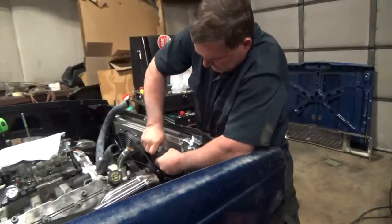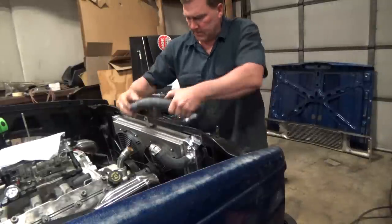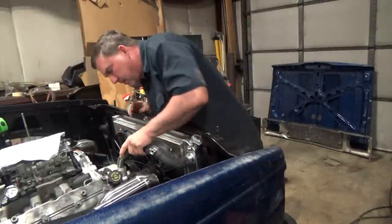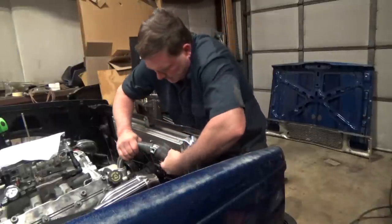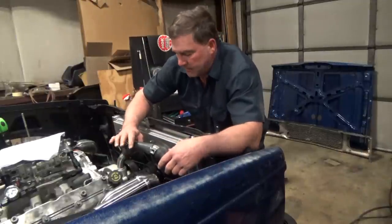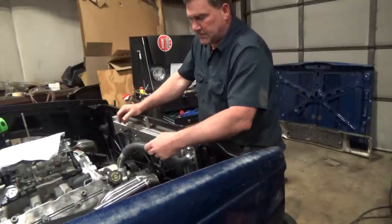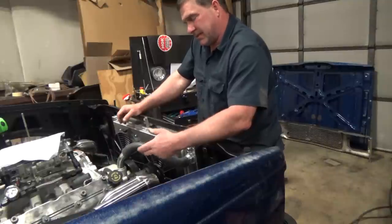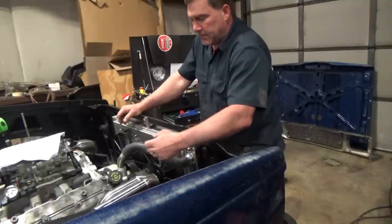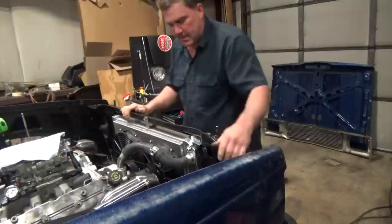I'm going to have to take this all back apart to put my clamps on, but that's okay. If we have a pinch where it kinks after it gets hot, we can actually wrap a hose clamp around that spot — it'll help keep it open. If I want to use a coolant temp sensor in the upper hose I can, but I'll probably just put a plug there to allow air out when filling with coolant. I think that's going to work just fine — almost like I planned that.